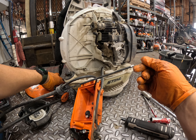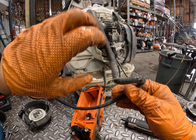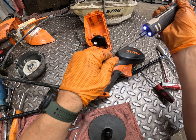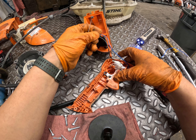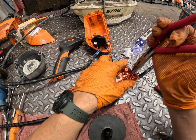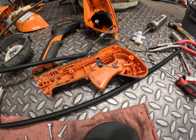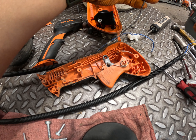Now we're going to start the install of the new cable. You can see it's binding — I have to literally yank it hard for it to go back to its spot. Remove the two screws from the control cover; this part is time-consuming so take your time — you don't want anything assembled incorrectly. Use pliers to pull the little piece of wire out that has the lever which shuts it off.